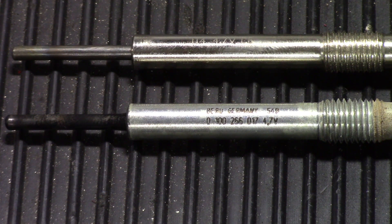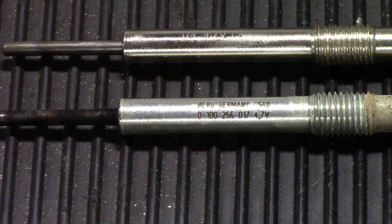We'll get the new glow plug put in, then get the fender lining put back on, and get our batteries reconnected. Then we'll use our scan tool to make sure we've taken care of the original code and issue with cylinder number six, and check that there are no other codes associated with the original problem or anything else. Hopefully now you have a better understanding of what's required to remove and replace the glow plug on this 6.6 Duramax. Keep in mind the same procedure applies to all the other glow plugs — you'll need to remove the fender lining on either the driver or passenger side, but that is the general procedure for this 6.6 Duramax.